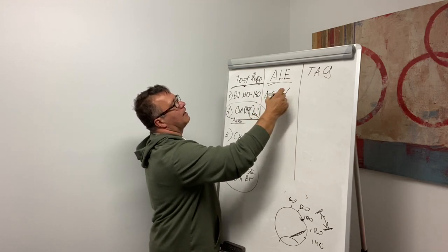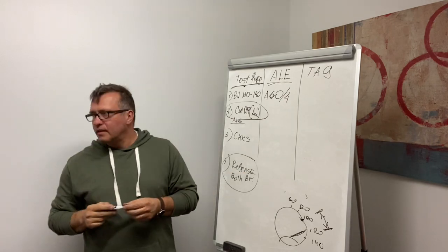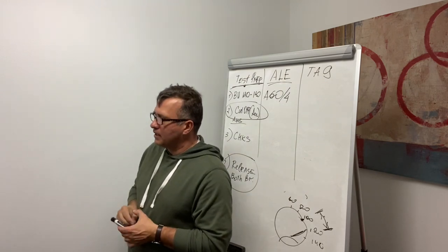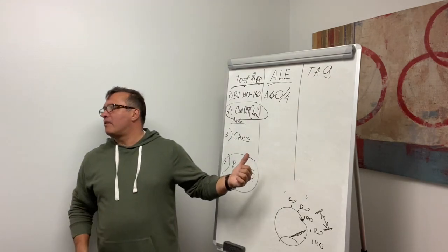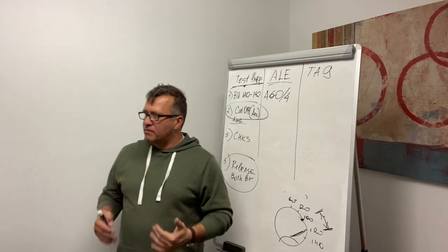60 seconds. How many PSI? Four PSI. We should not lose more than 4 PSI during 1 minute. If you're doing everything properly, it will never lose more. But we will go through some scenario right now. An interesting scenario. You need to be prepared for this one as well.